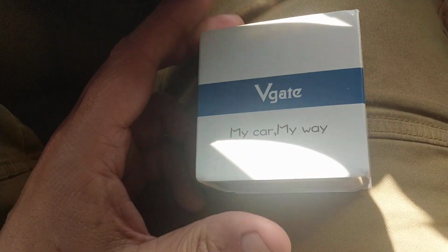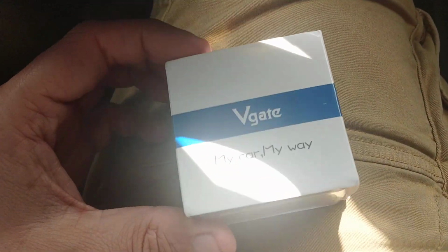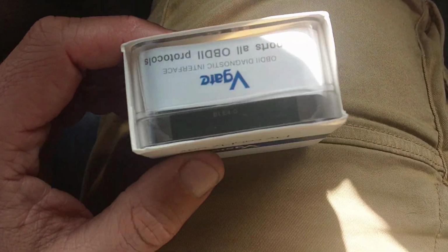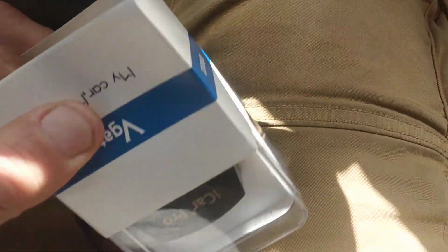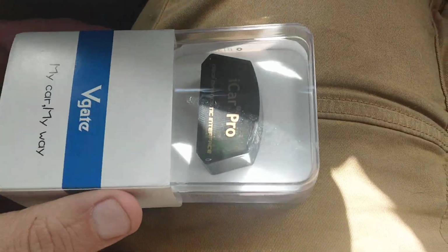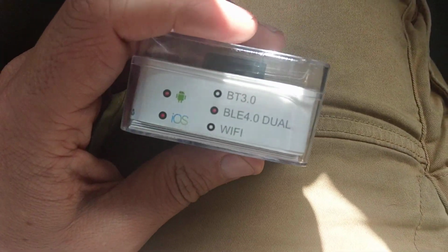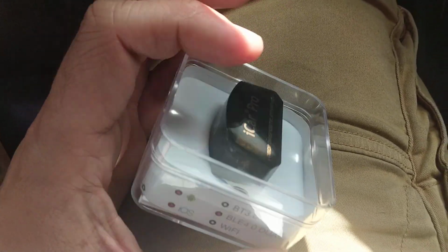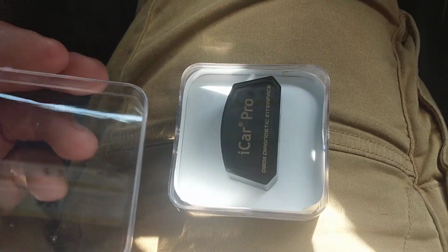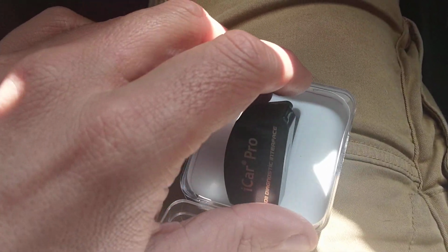the fault code was, and they're handy for that, especially if you own a Jeep, and you get those all the time. However, this particular one is a little bit more fancy, apparently. The box itself and the unit itself obviously look a little fancier, but that's not really the trick here. It's the protocol that they've switched to in the Bluetooth band that allows them, I believe, to access a separate set of data that comes through the OBD2 interface.